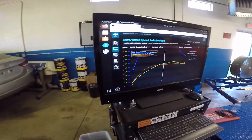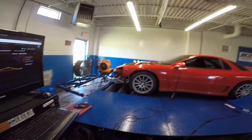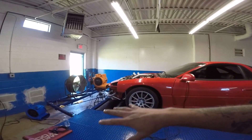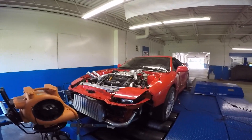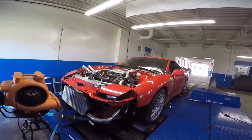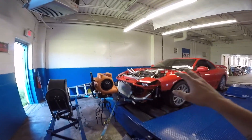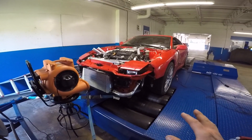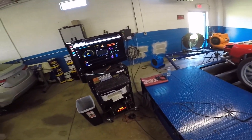The tach got messed up so it made 479 - pretty much 480 - on 18 pounds of boost, and it was super rich so he's got to lean it out a little bit. He's got to turn up the duty cycle because I have more surface area with a bigger intercooler, so we're down five pounds of boost. Cooling mods work boys, the proof's right here in the pudding. Also for everyone paranoid about the radiator overheating - even at full throttle at over 150 miles an hour it was only 190 degrees, so we're good. Here we go boys, turning the boost up.